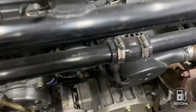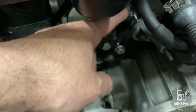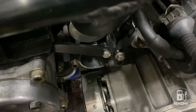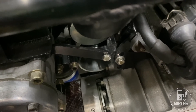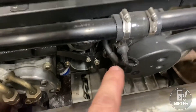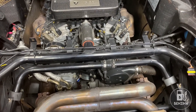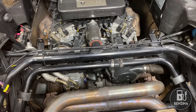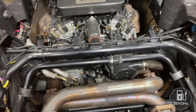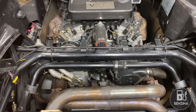In order to set the belt tension you need to loosen off this bolt here where the alternator is, and then there's another vertical bolt that gets screwed in or out to add or remove tension. Tightening the bolt adds tension and loosening it takes tension off. Because the belt is really long and you're only pulling on it from one spot, what's necessary is that you put a new tension onto the belt, run the engine for a few seconds — just not enough for it to get warm — then double check the tension, because you want to always be setting the tension on a cold engine.